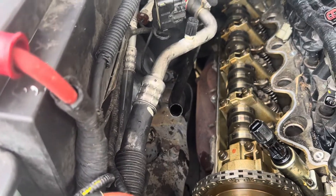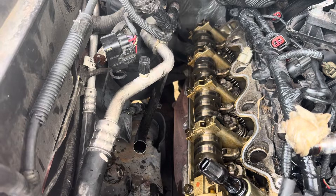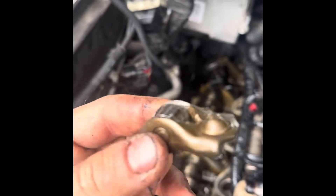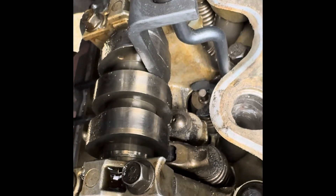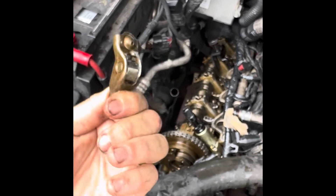We'll clean up a little — some dirt got into the cylinder head. Now we're going to work right here on these roller rocker arms — that's almost half the job done. I want to show you this roller arm I just pulled out of this 5.4 liter Triton — it was making a horrendous tick. Here's my specialty tool. You can see the lobe on the cam is definitely worn, but not too much. We'll see if we need to replace the cam as well, but this tool allows you to replace the rocker arms without removing the cam or timing cover.